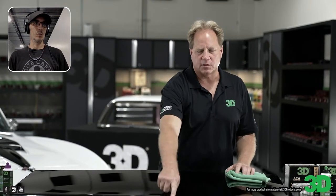So the pigment can adulterate or pollute or dilute or modify the hardness of the resin, which we all call paint. So when working on single stage, just be knowledgeable of that. If someone brings you a classic car with single stage black paint, first of all, the paint's old, it's brittle, it's dried out, and you don't know who buffed on it before you and what they used, and it could be very thin. Because it already is very soft, you just want to be careful around things like raised body lines and edges so you don't burn through.